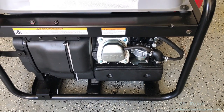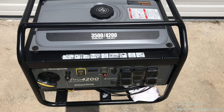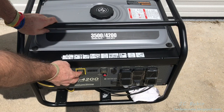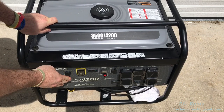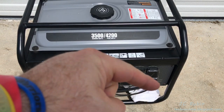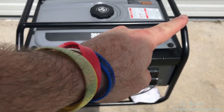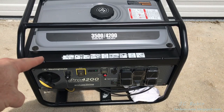At this point we could store it or run it, but if we run it we need to be prepared to drain the bowl — or we'll be doing this all over again. The smart thing is to run it and then drain the bowl to confirm the repair worked. Turn on the fuel valve and wait a minute for the carb to fill since it's empty. Once filled, give it a pull — it started easily, no problem at all, freezing cold. I hope you found this helpful and entertaining. Click the like button and subscribe for more videos. I'll be converting this generator to natural gas — a cool upcoming project. Thanks for watching.